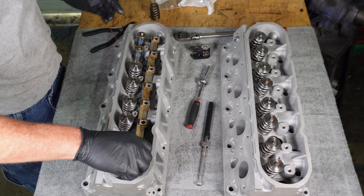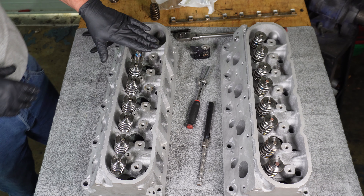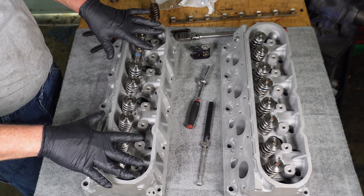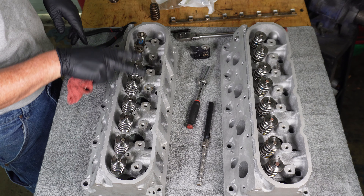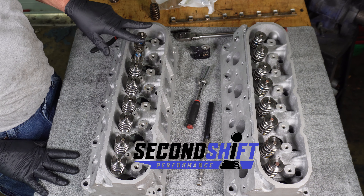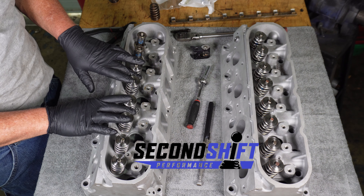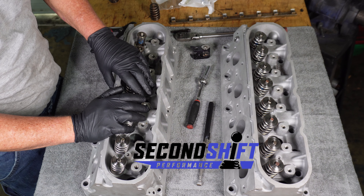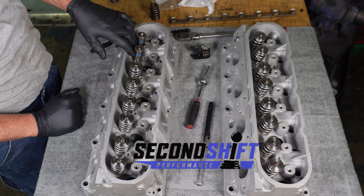Now we can put these heads on the motor. First we've got to put some clay on the piston, then bolt the heads down and bolt the rockers down on this cylinder — and maybe the two end cylinders as well. Then we'll measure our piston-to-valve clearance. This will give us a really true reading of the maximum amount of lift we'll get even when the lifters are fully charged up, since the checker springs keep preload off the lifters and we can't simulate the oil pressure that will fill the lifters.